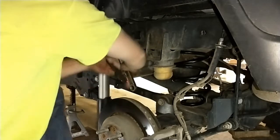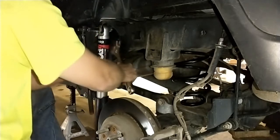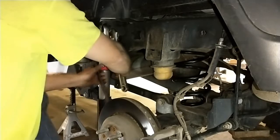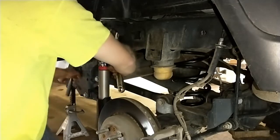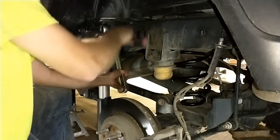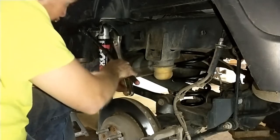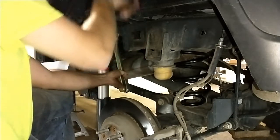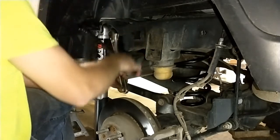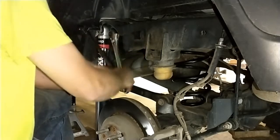Now, one thing I'd like to point out, everyone is going to have a little bit different lift heights out of doing a project like this, because the spring compression rates, like I've shown you, are going to be different on each Jeep depending on what options there were, whether you had the max tow, whether you had the steel bumper or the plastic bumper, etc., etc. Because of that, your springs may be stiffer, closer to the Rubicon springs, or maybe the Rubicon springs you get won't be quite as stiff as the ones we got. I'm pretty happy with the ones we got because from what I can tell, they're not the heaviest compression rate that Jeep has, but they're pretty darn close. I think for the rear there is one heavier rating than the one we got. And I'm guessing that's for a Rubicon with maybe the steel bumper.